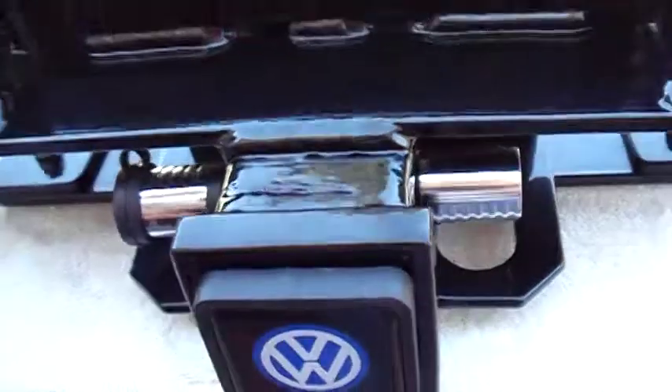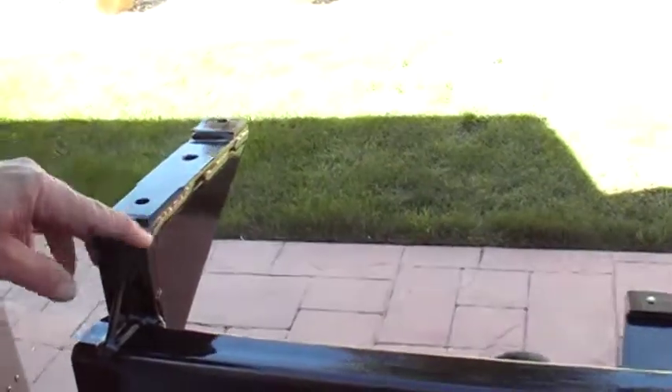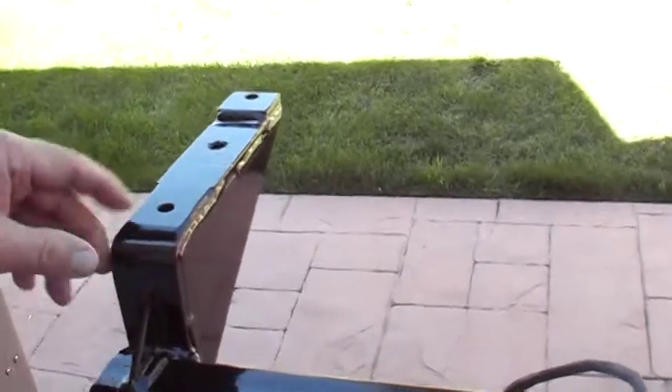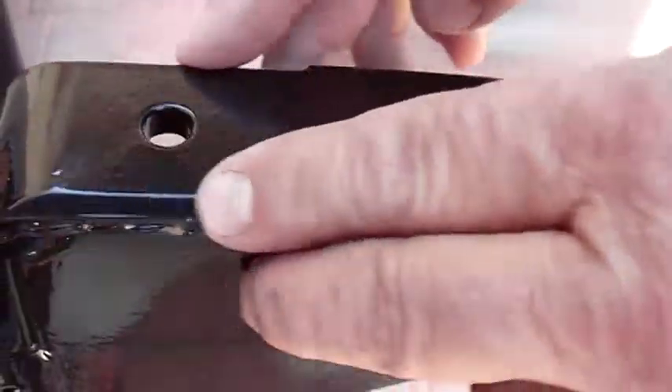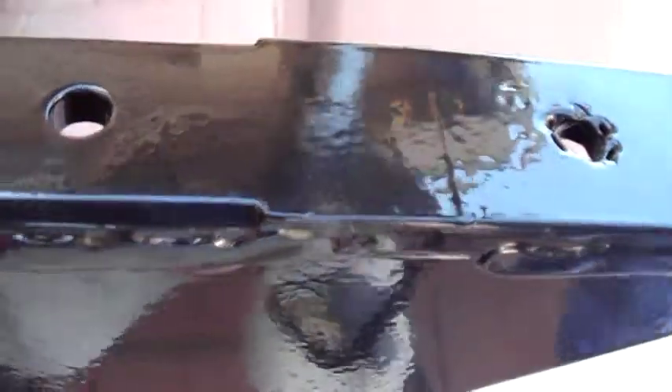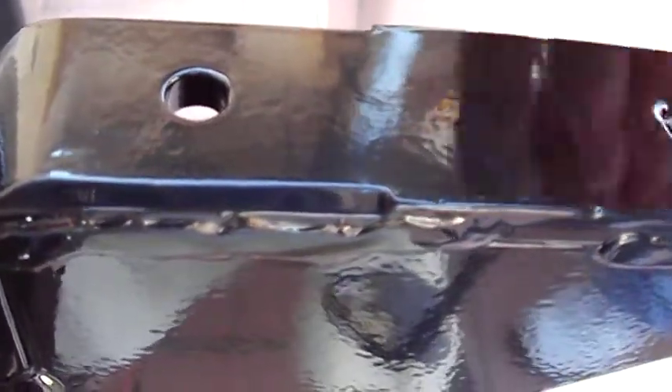I hope it was an informative video. I was going to mention why I trimmed these little bevels on the brackets — on both sides. If you notice how I had to put a little bevel on here, it's about three sixteenths across the face of it. That's due to how the stock bumper bracket fits over this. If you don't taper this back like I did, it won't set flat on the bar here.